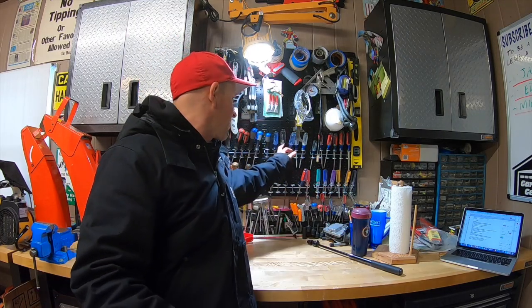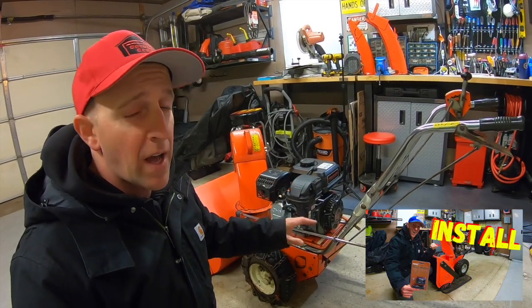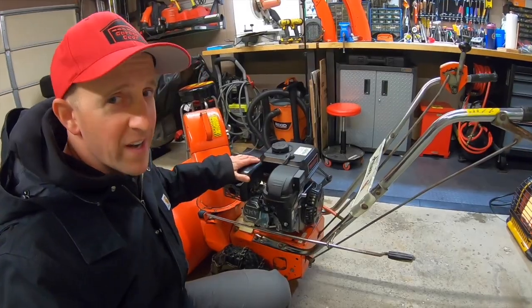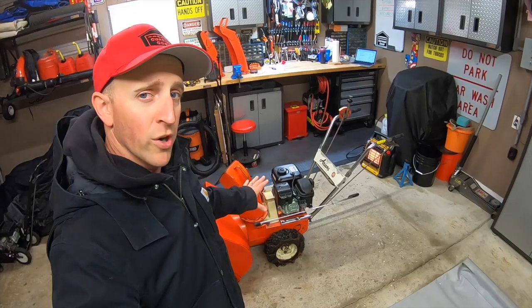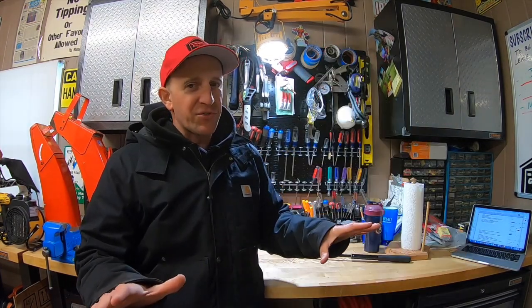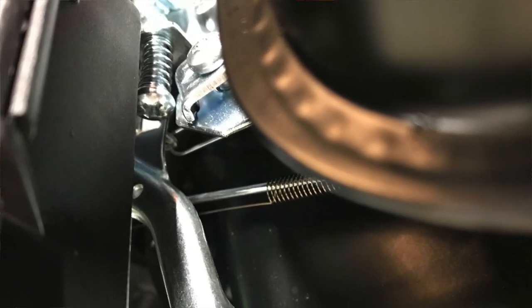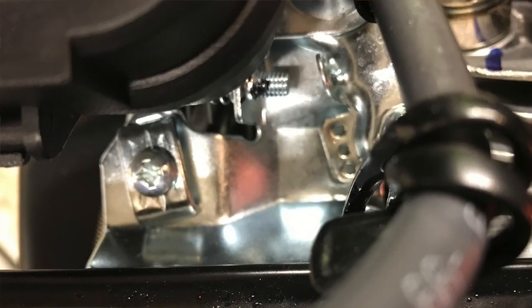All you're going to need for this application is a Phillips screwdriver and an hour meter. First, you'll need to have an hour meter installed or hooked up to your engine — super cheap and easy to do. I'll have a video link down below in the description on that. Right now this engine runs at 3,800 RPM right out of the box. What we're going to do is kick it up to 4,100 RPM. The community recommended anywhere from 4,000 to 4,500 RPM, but 4,100 seems to be the sweet spot. First, locate the throttle screw on top of the engine — on this Predator it's between the air filter assembly and the gas tank. Take a Sharpie and mark that screw where it currently is.